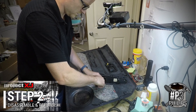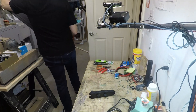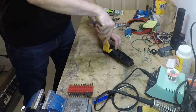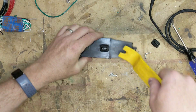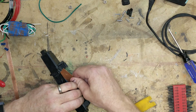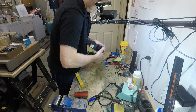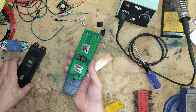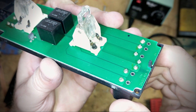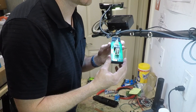The cluster removes from the door trim card with screws, and then there are more screws on the back of the module. The switch caps are the tricky part — they do require an unreasonable amount of force and can disconnect at unreasonable speeds. Work the perimeter tabs loose on the back with a shim. We had a copper scrap piece handy, but a better option is plastic, such as a laminated ID card. Take a close look — these connections are not nearly as bad as the one on the driver's side, but I do see a couple starting to crack and pop up, so that could be the source of our problems. Either way, we're in here now, so we're going to reflow all of those and see what that does for us.